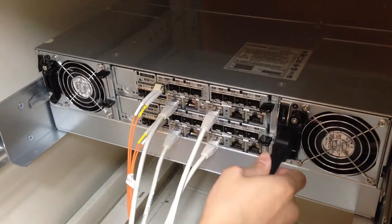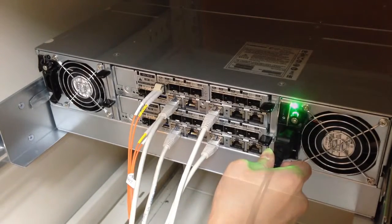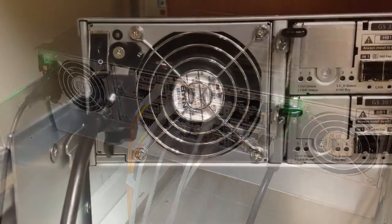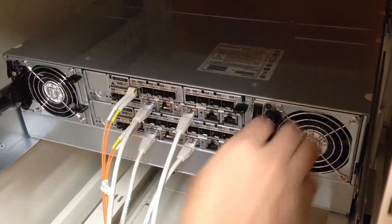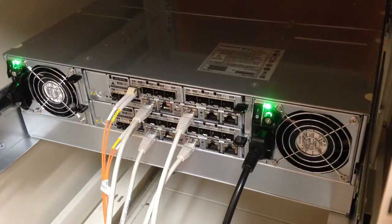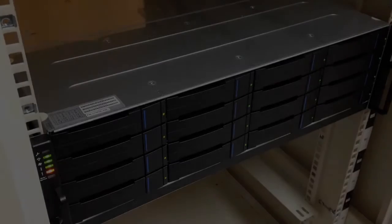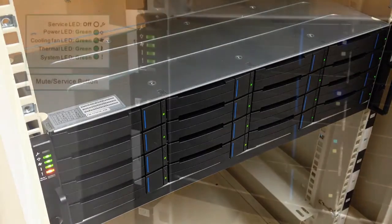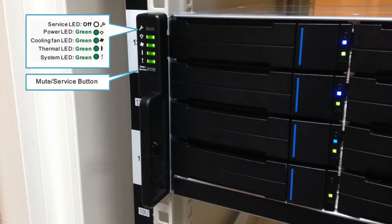Now we will connect the power. Plug the power cables into power sockets on both sides and the power LED should start to blink with a green light. Simultaneously turn on the power switch on both sides. The power LED should show steady green light to indicate normal power supply. Trays with hard drives will have their indication lights turn on at the front of the EONSTOR GS. There are four indication lights on the left — the machine is operating normally when they are steady green. You can check what these LED lights mean in the quick installation guide.